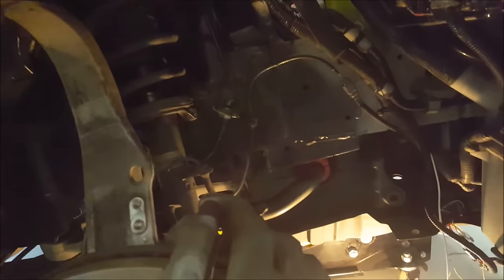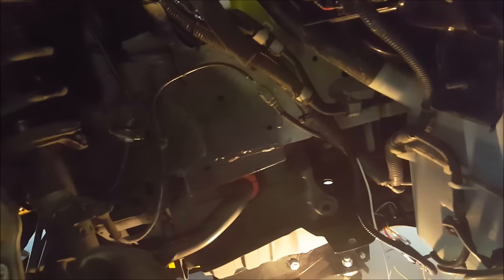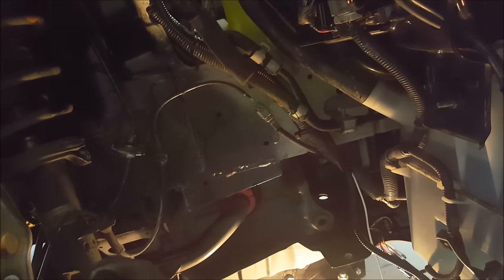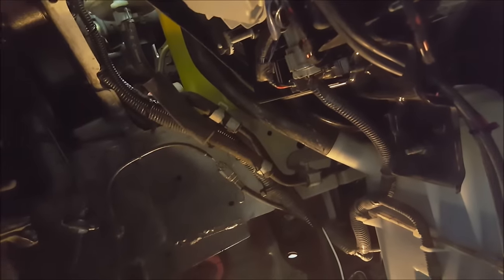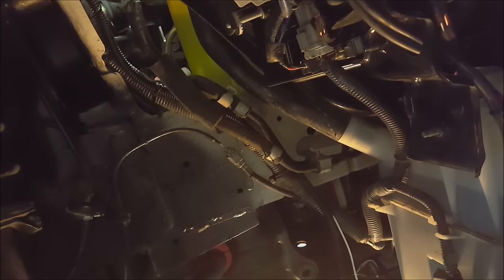On the passenger side is where the battery is, so this is where you want to do all your main wiring. I'm going to take this one step further and add a relay, because I think this is going to work a lot better going straight off the battery. I could just hook up into the parking light circuit to give the module power, but let's go one step further and give it all the voltage it needs. Even though it doesn't draw a lot, proper voltage is very important.